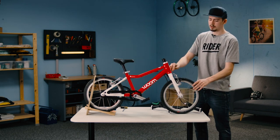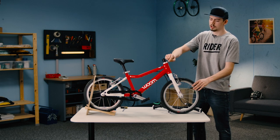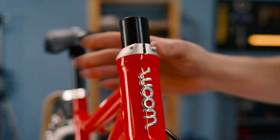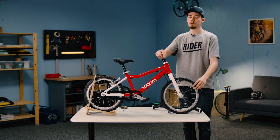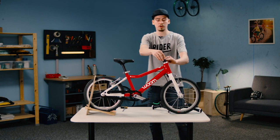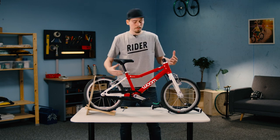Is the silver cap aligned with the front wheel? There's a sort of slot here. If it's wonky, just line it up with the tire facing forward. It may take a bit of force because the headset is currently held tight by the tool.